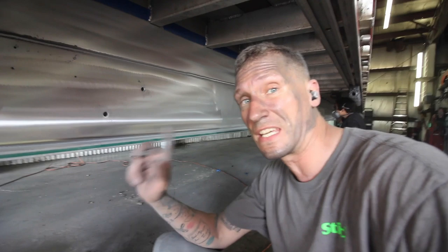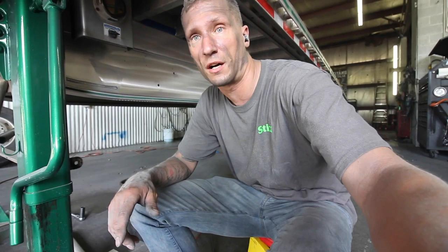I don't know how well you can hear me here, but if you see where he DA'd, back to where I rotaried, I don't stop doing the rotary until I can see that the DA is gone. So always just wait until you see that the DA is gone. It might take two or three passes, and you'll burn through a ton of sandpaper while you're doing this.